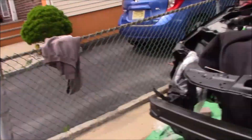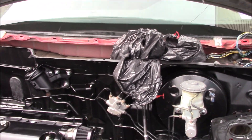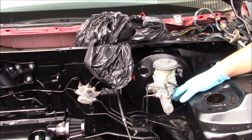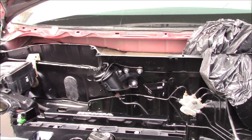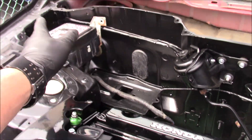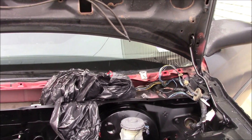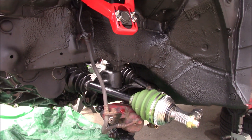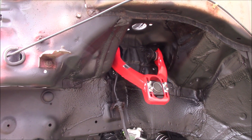We're back. So we can see some changes — everything that Carter's done is on the firewall. He put the booster in, which is a brand new brake booster, and the brake master is the original. He's got the new fuel filter, parts sent to quick strip, brackets, the battery tray, fuse box mocked up but not bolted down. He's got the suspension started — Driveshaft Shop level zero street axles for the swap, and Skunk Two upper control arms, the adjustable ones.